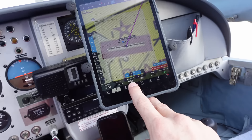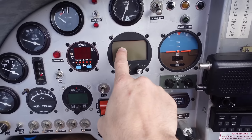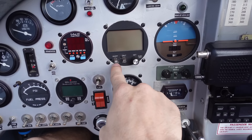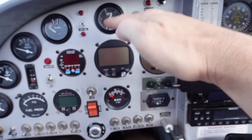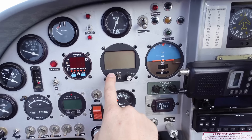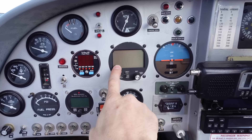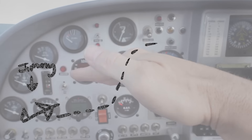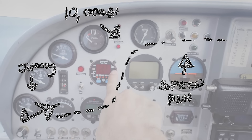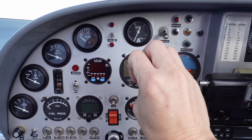Why do I do these things? We're going to have our ground speed right here. And then when I turn this on, we're going to have our indicated airspeed. And then if I flip this little switch here, it'll be our true airspeed — that'll calculate for our altitude and stuff, and that is going to be the one that we go by. I also want to know how much fuel we're using going that fast. So we're going to be climbing to 10,000, seeing how fast we can go, and then what our fuel consumption is at that speed.